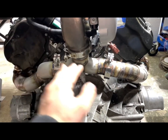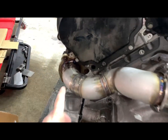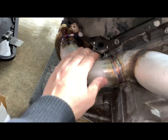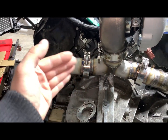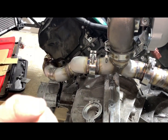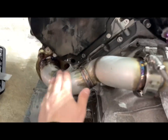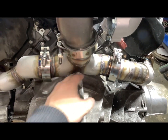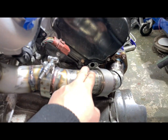Like before, you do the whole prefab and everything was a perfect fit, no issue. But when you start welding this stuff, because of the heat, it starts moving in all directions — it will move and stay that way. In my case, I welded all this side first, made the wire connection, then connected everything back together, and my right side was completely off.